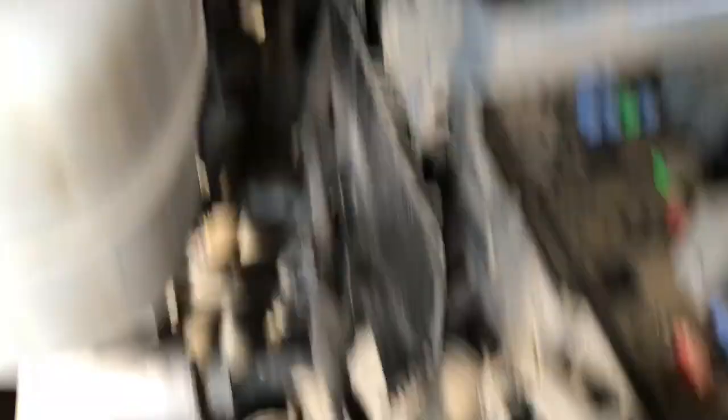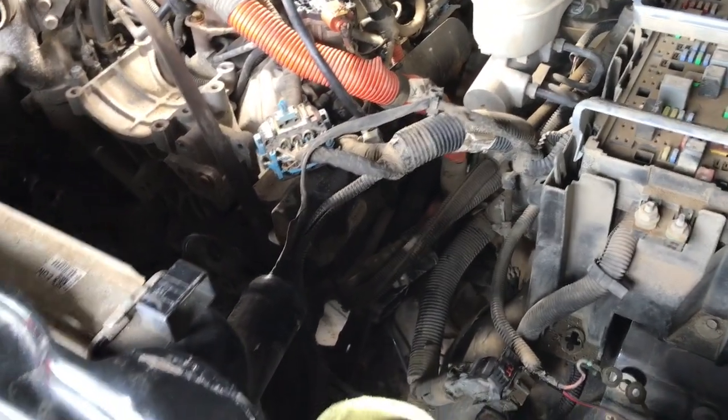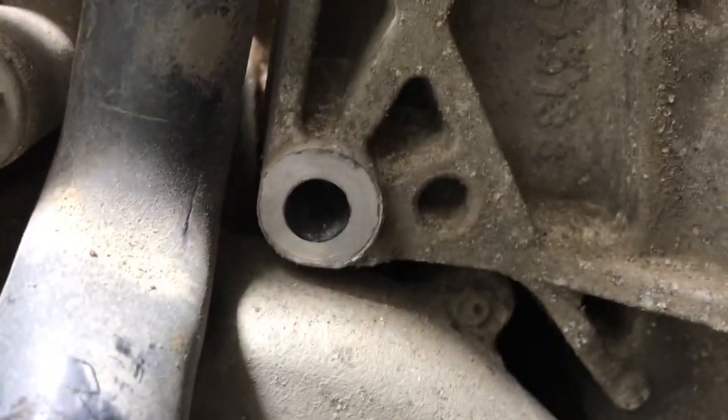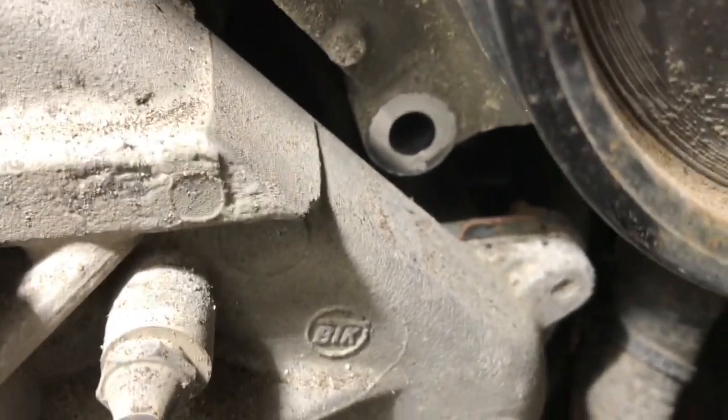We've got the two wires off of there. Pulled the add-a-fuse, laying right there. That wire comes over here and ties into the harness right over there — pulling a little red tab back and then pushing the clip to pull it out, so that's out. All these wires are going to stay with the engine. I think before I can do that I've got to pull the power steering pump. The power steering pump I'm pulling off with the air conditioner bracket. There are two nuts right there, that's one bolt that holds it on, and then down there, kind of hidden below this pulley, is the fourth bolt, and that loosens up the entire bracket so it's ready to come out.